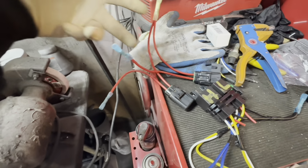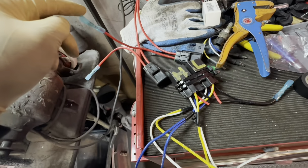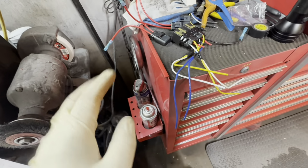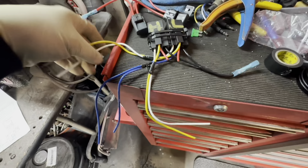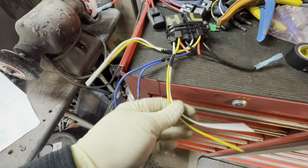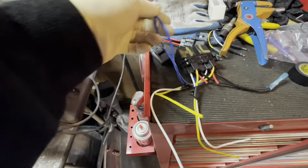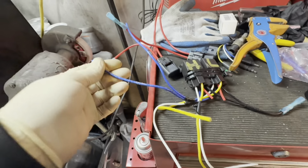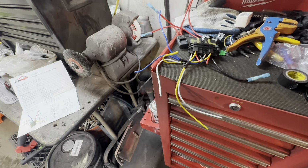So here, that's the start of it. The battery will come in, out here, into the relay. I know some people freak out about wiring, but it looks a little bit confusing when they start going like this. It's all the same thing. These two wires are for the low, these two are for the high. These are each gonna go to one of these. It really doesn't matter which one you pick. They're both each getting fused, so whatever it lays out better in the truck. And then just zip tie it all together, and it's good. Super simple.